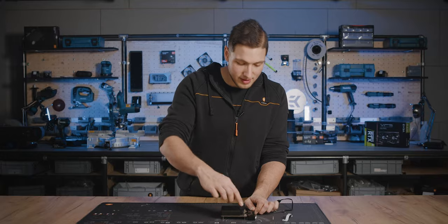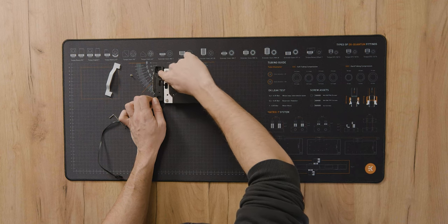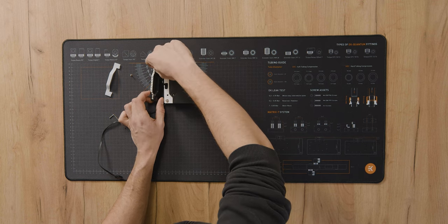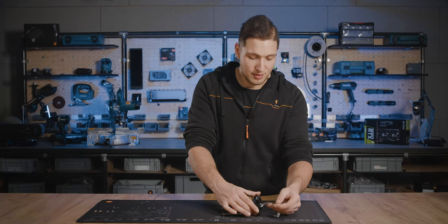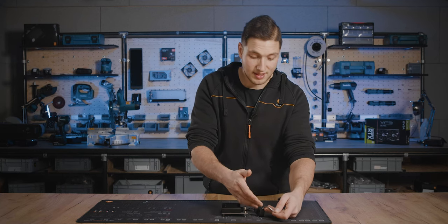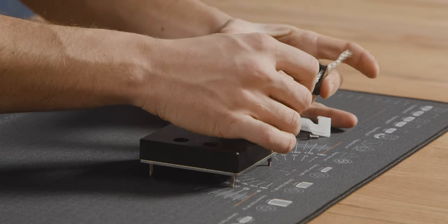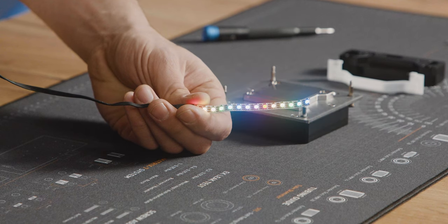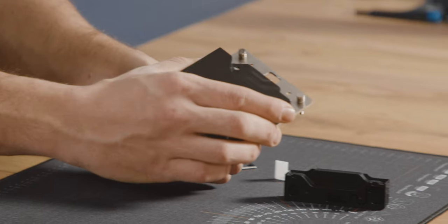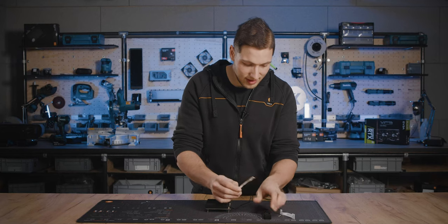As seen from the top-down view, the dRGB cable goes through the block into this channel right here, and the LED strip itself starts right here at the edge of the standout. Beware that the LED strip is glued in place with double-sided tape, so it's just a tad sticky. Carefully remove it, then pick a replacement LED strip — make sure it works beforehand — and then just route it back through the block and through the standout.